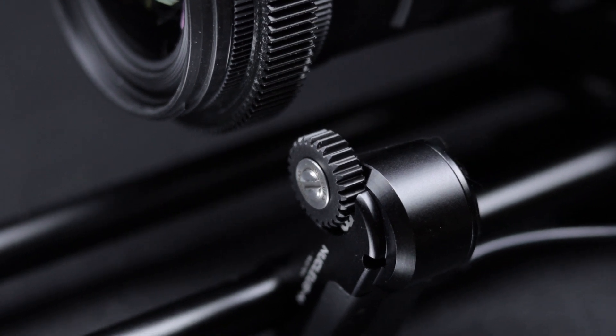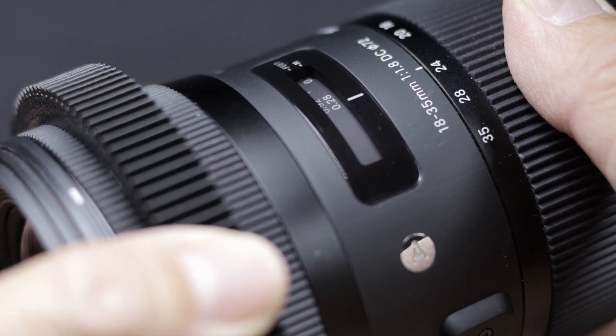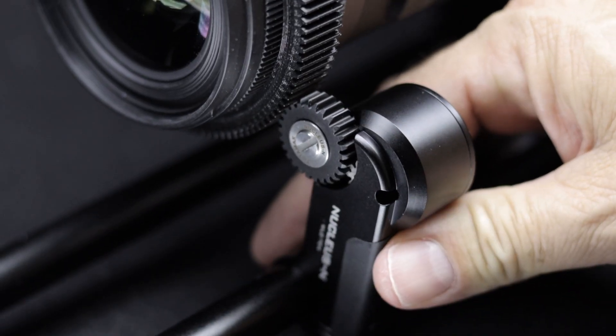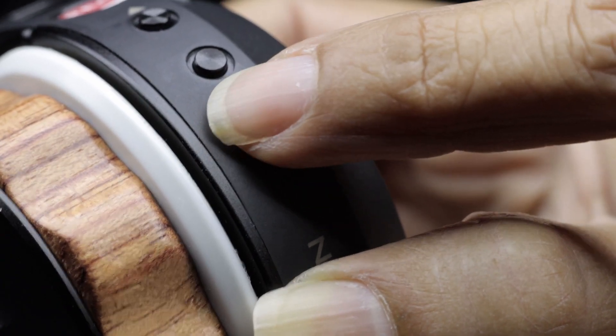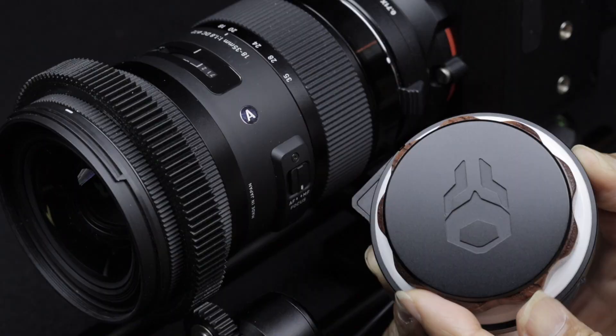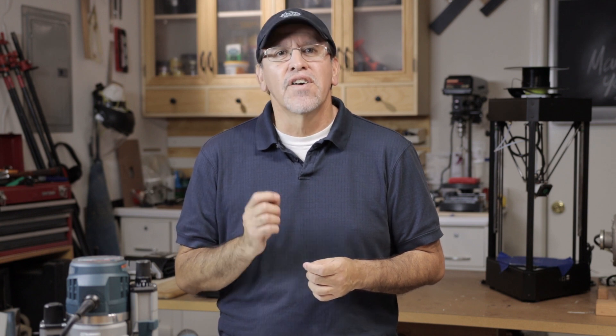His video did get the gears rolling in my head, and the light bulb turned on. I told myself: just use the same A/B methodology with a slight change. Make sure not to engage the focus motor. Move the lens focus ring to the minimum focus distance, then rotate the focus wheel until the OLED displays 999 or 0 — whichever you feel comfortable with. I prefer 0, since to me 0 represents minimum focus distance and 999 represents infinity. Now engage the motor onto the focus gear. Do not use the calibrate function — just hit the Set button to set the A point. Turn the NanoFocus wheel until the focus window reads infinity, then hit Set again to set the B point. Now you have a calibrated DSLR lens. You'll need to repeat this process for every lens change.